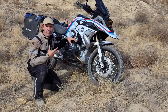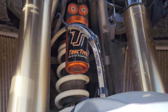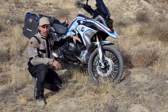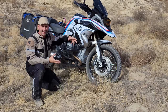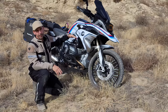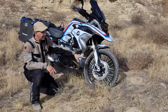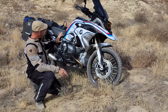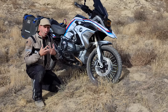The other change that goes with these wheels is suspension. Because I went from a 19-inch rim to a 21, I changed the attitude — the way the bike sits. It sits nose high as soon as you put that taller wheel on. So I upgraded my suspension front and rear to better quality suspension and to correct the ride height. On a GS, the difference between normal GS suspension and the rally or GSA suspension is 25 millimeters, while the difference in rim to axle is 20 millimeters. Switching from a GSA front shock to a standard and maintaining GSA spec on the back means my bike was level. It's not just about upgrading suspension — you have to think about all the other changes you made.